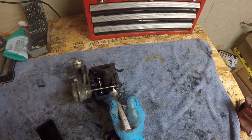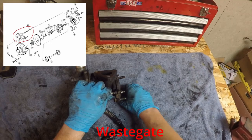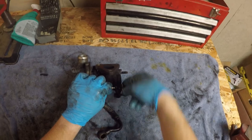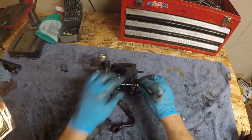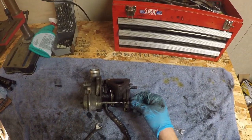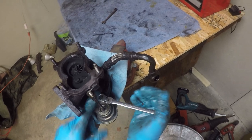We're going to kick this teardown off by taking the wastegate off. Start by marking the wastegate rod where it actually sits, and take a picture of it as well. That's very useful for counting the threads on either side when you're putting it back together, because it is spring loaded. Take lots of pictures all throughout this build — it's going to help you a lot. But the paint marker isn't exactly foolproof.